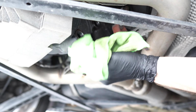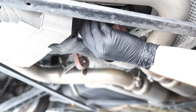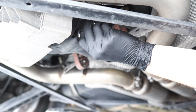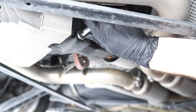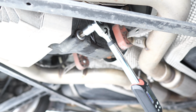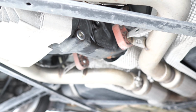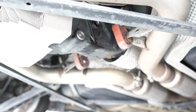So after we're done draining the fluid, you want to put the drain plug back. The torque specs are also going to be in the description below, but that's going to be 56 Newton meters of torque or 41 foot-pounds of torque for both of them, for the filling and draining. Okay, first one is done. Okay, now comes the tricky part.